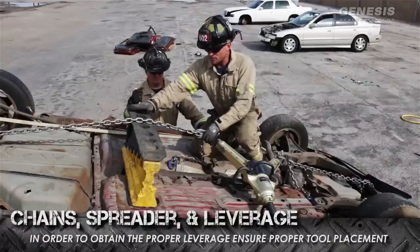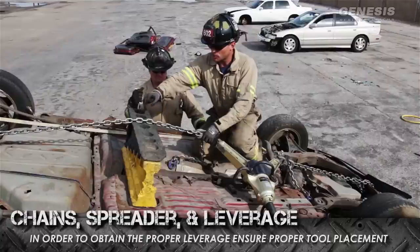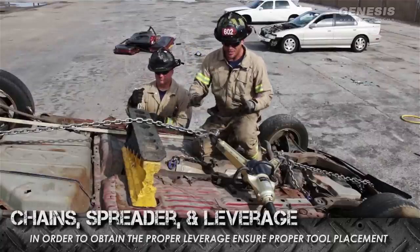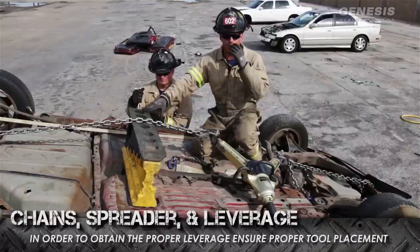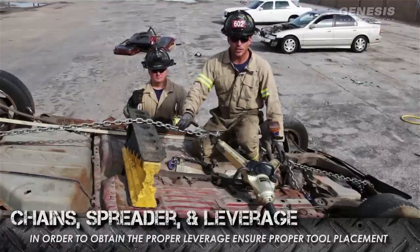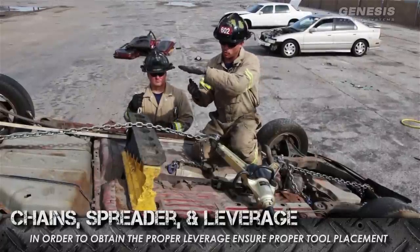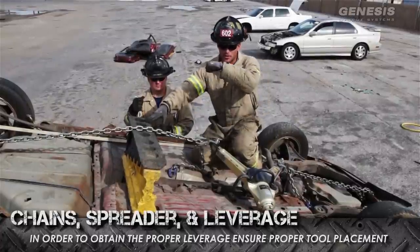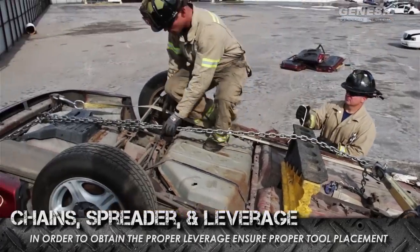As we work back, we have two pieces of step chock stacked on top of each other. This creates the leverage to pull up on the rear end. You can still achieve this same movement without the cribbing in place. The problem with that is you use a lot of slack of your chain in order to pull the back end in before popping it up. So to alleviate that, we just build it up to create that leverage.